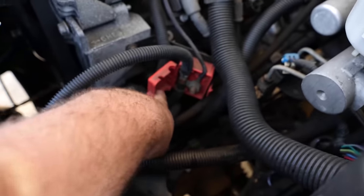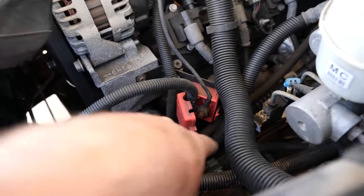I got the fuse swapped out and switched the wires over. I've been driving around for a good half hour now and these things are working incredible. Air conditioning — you come to a stop and it's still blowing ice cold. The temperature has not gone over 210. The gauge is literally functioning and reading exactly how it did with the clutch fan — I wouldn't even know this thing had electric fans if I didn't install it myself. Noise-wise, the AC is on and they're running at high speed. If you get out of the car you can hear them, but inside you can't hear them over the blower motor.